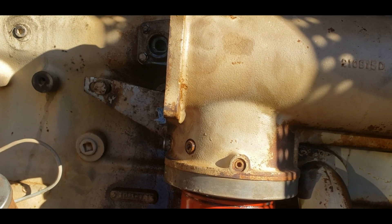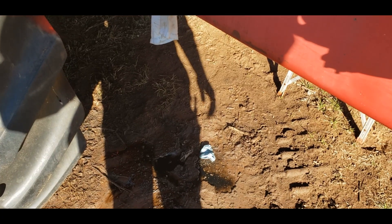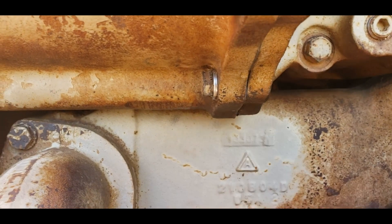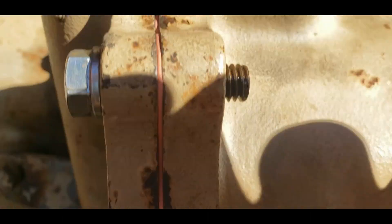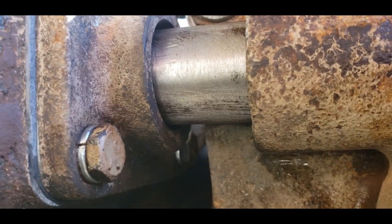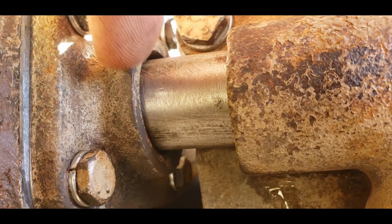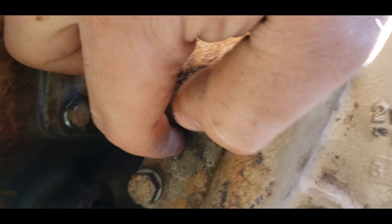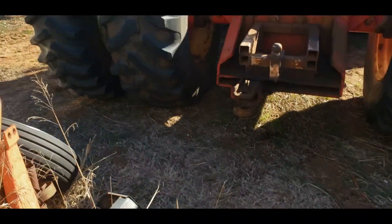We're going to seal it up with a different gasket and try it again. I also noticed a leak starting here and another one down under here, so I tightened all these bolts — they had about another eighth of a turn before they really snugged up. I don't want to crank down on them but they were a little loose. Still some drippage, but I figured out: the gasket around the front is dry, the area around there is dry, and we're all dry except back behind the backing plate — which tells me one of those O-rings is bad.